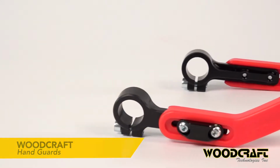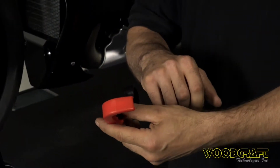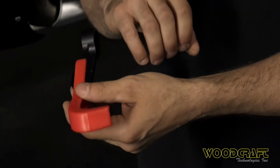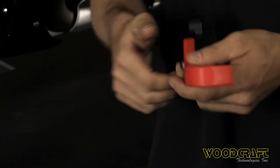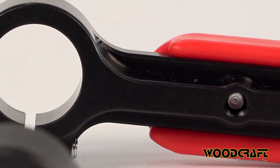You'll typically take the bar and run it right through the handguard itself and then place all your throttle and controls right there. And what this does is this allows the curved part of the brake guard to protect you from accidental side contact from another rider. So we did a bunch of these things to make ours unique, as we always do.